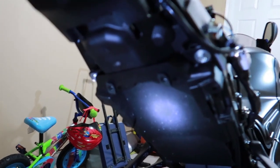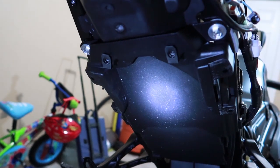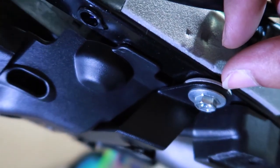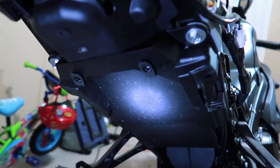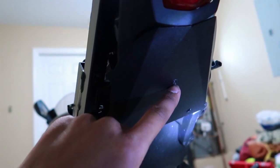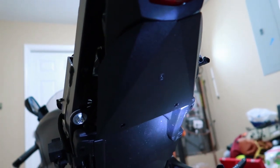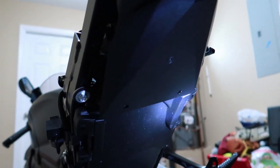Alright, so I just installed the first bracket, just this here. The two nuts here that you take off from your existing fender when you buy the bike, you reuse those for this bracket. The kit comes with a washer here. You want to install the bracket first, in the middle, washer at the end. Got the bottom plate on, hand tightened with just the one screw that the kit comes with. That's a 4mm Star key or Allen key, whichever one you want to use. Star key preferably, since that's what it is.